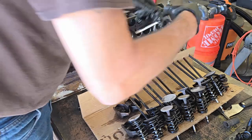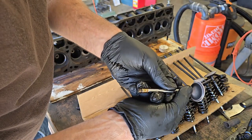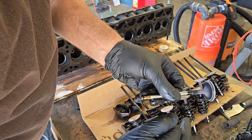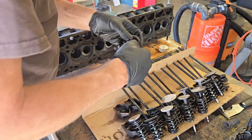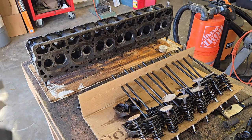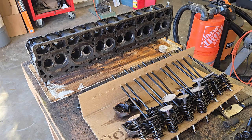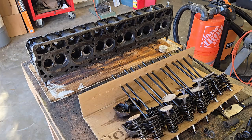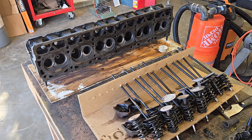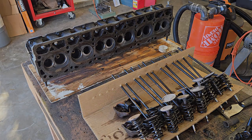I think most good mechanics would tell you that that looks a little bit distorted right there. We'll look closer. Most mechanics would tell you if you're going to pull the head off of an engine with this many miles and grind the valves, that you should go ahead and put in rings and crank bearings, new seals. But you know what? This is a budget build. We just want to get to Moab and back to the Easter Jeep Safari. Okay, I'm going to get these guys all cleaned up on my bench wheel, and I'll come back with an update.